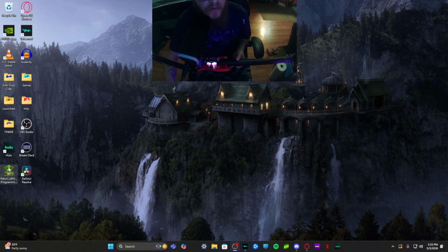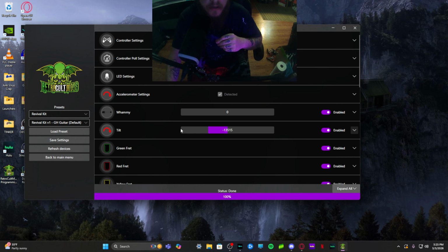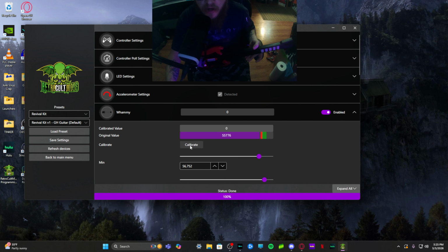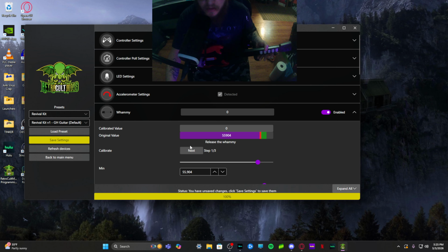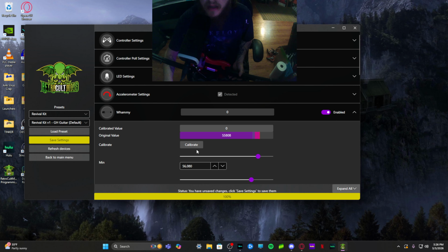Let's open the programming tool. Link will be in the description. The revival kit should pop up right here. Hit configure. Now, first thing we're going to do is the whammy. So we're going to hit calibrate. This is release the whammy, so don't touch it. Hit next. Push the whammy all the way in. While doing so, hit next. And then now you set the dead zone. Just push it down ever so slightly and hit next. Now your whammy is calibrated.